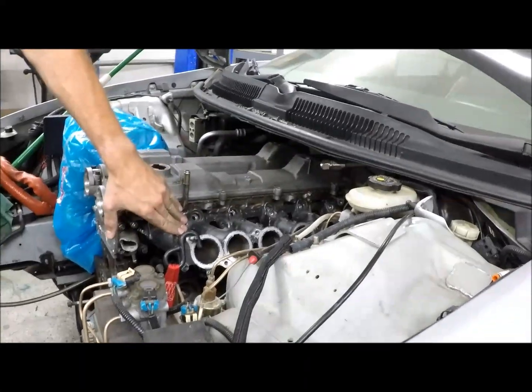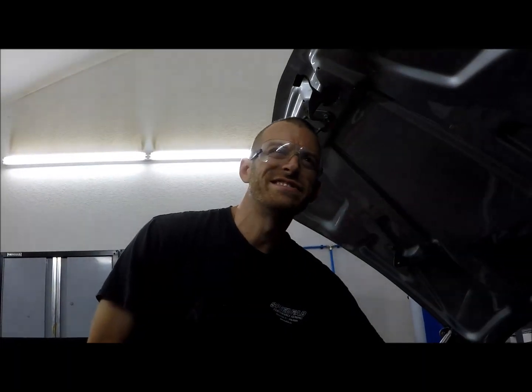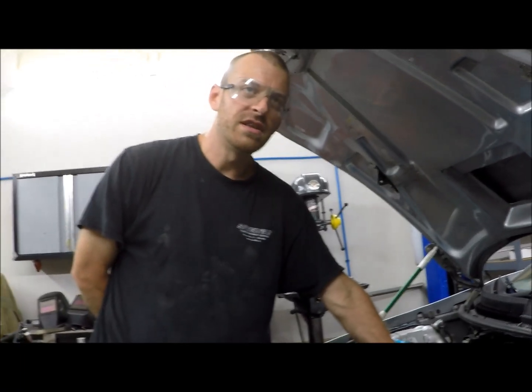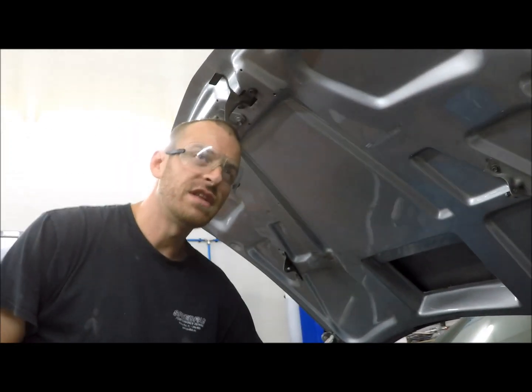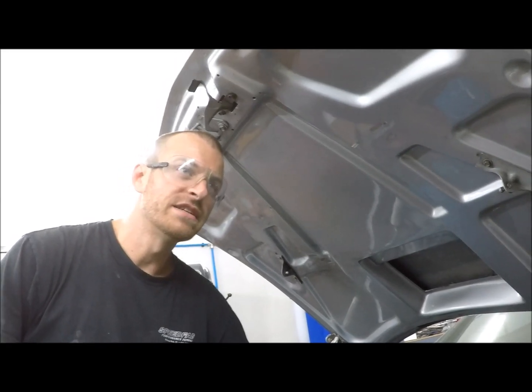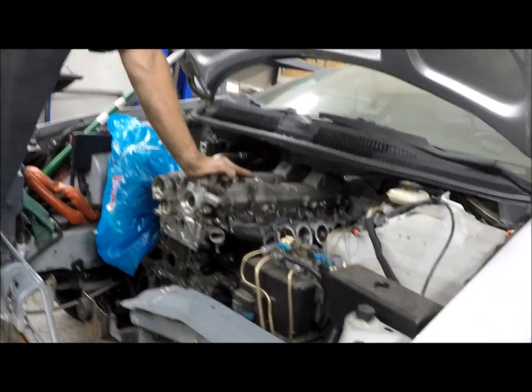The aftermarket manifolds that I found use a 4-bolt 90mm Ford throttle body, and they're like $400. And it doesn't really flow any better. I've built a lot of LS motors, I've boosted a lot of LS motors, and those 90mm gold blade throttle bodies just work really nice. Oh yeah, they're money.